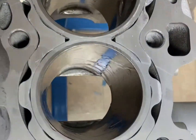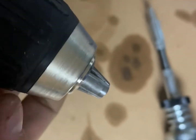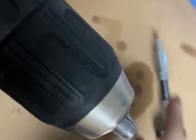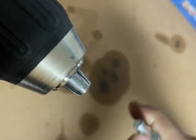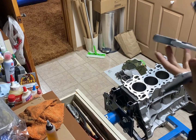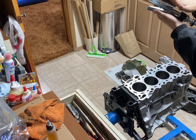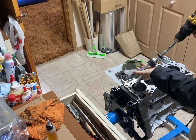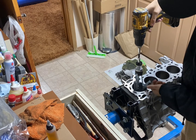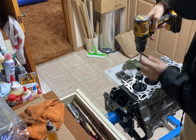Once you've got your cylinder walls all lubed up and coated with oil, you're going to want to get your drill and loosen this until the attachment fits inside the drill. Once you have the drill attachment on the drill, you're going to want to push it down, compress it, and then slide it in the cylinder. Make sure that these discs here are lined up briefly against the cylinder walls.